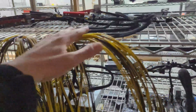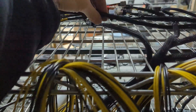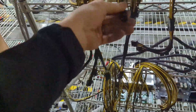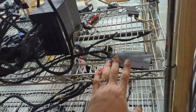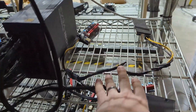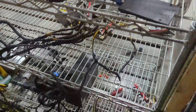You can see the backside of it, getting everything ready. We've got the risers all set up here. We're running two per slot for PCI. Then we're running two of these for GPUs and one of these for GPUs. Our SSDs are already complete — we copied them over and got them all ready for all 15 rigs. We've got more risers here, running these risers on SATA, two per SATA plug — works just fine.